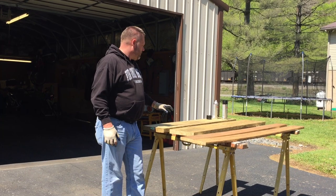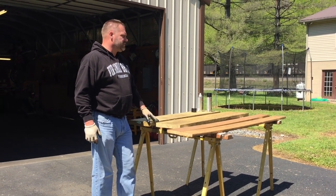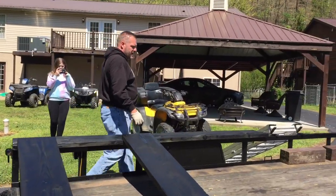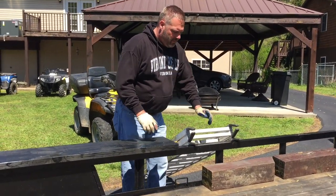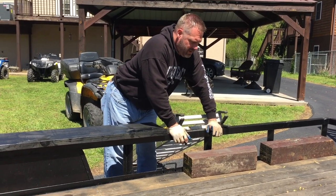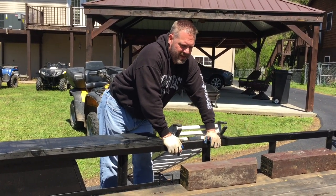All right, we've got, as we said earlier, two more of these 2x12s here. On this upper end, see if you could follow me with the camera right up here. We don't have to have the board on the side to level it up. What I'm thinking is we'll get rid of these 6x6, and I've got two of those 5/4 boards over there. And I may have to put a middle brace. A 5/4 board probably ain't gonna hold it